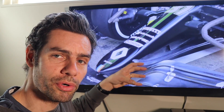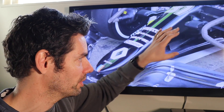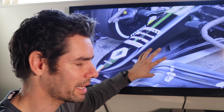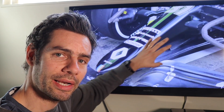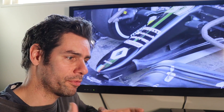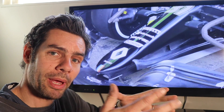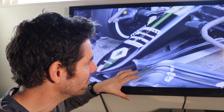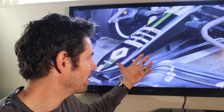The Y250 vortex is such a crucial vortex in the work it does further downstream, having passed through the bargeboard area and around the rear end of the car. A lot of people move their suspension up high to give a clear pathway through, but the narrower nose cone is another method for opening up a very clear channel to allow that vortex to pass through uninterrupted, giving more space for it to build up and travel along the car.